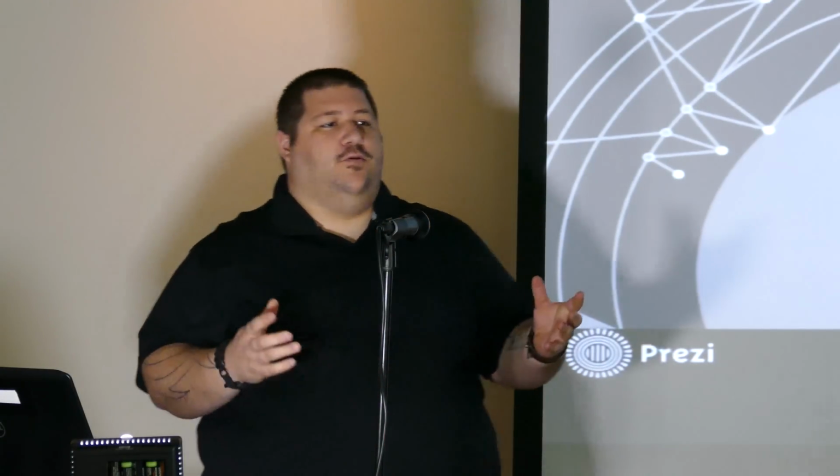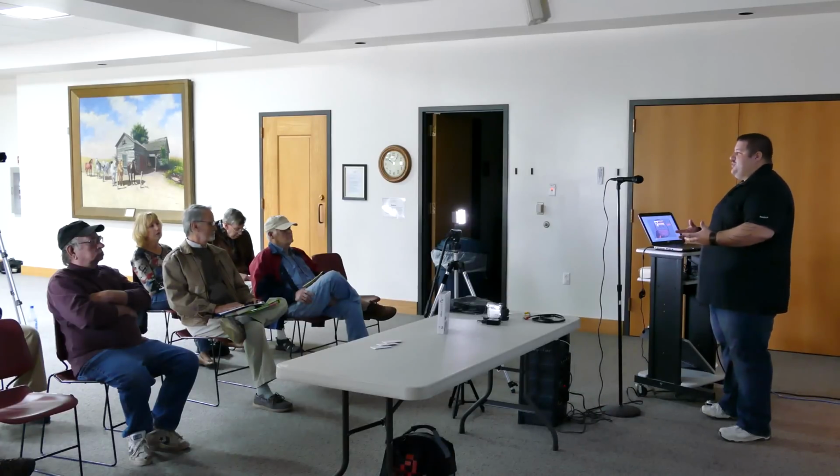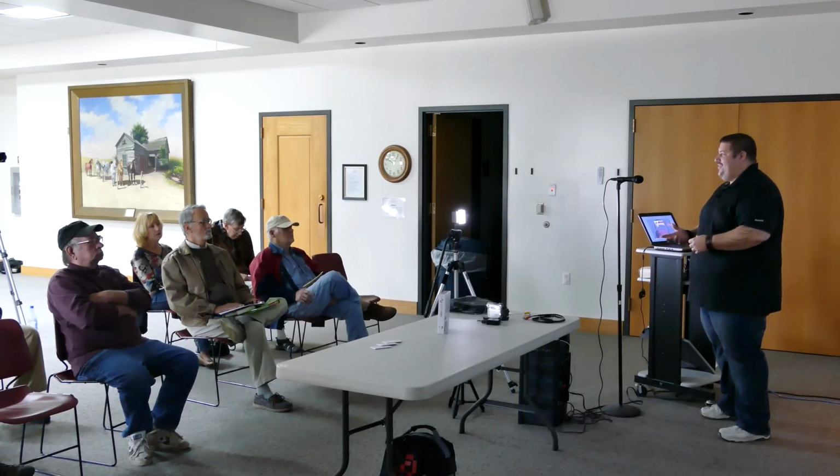How many people used to have speakers next to their TVs at any point in time? Did you guys ever get the green hue if you got your speakers too close to them? I know the older TVs used to do that really bad. That's because of the magnets inside the speakers. Now, who had VHS tapes in a storage tower next to their speakers? That's really bad. That will degrade a tape fairly quickly. That's something to be concerned with when storing tapes, and not something they really tell you.